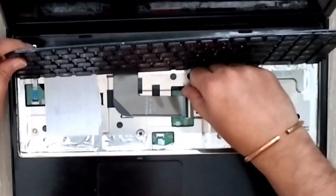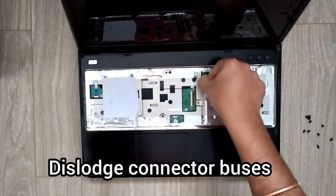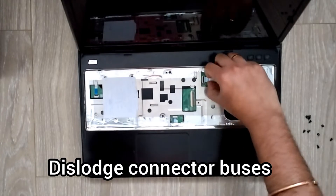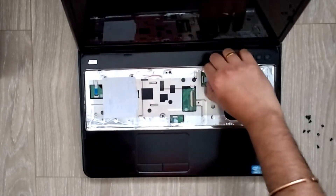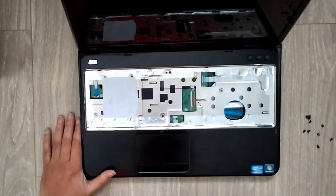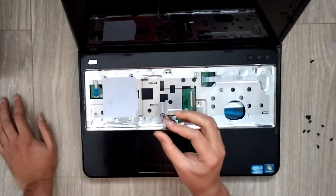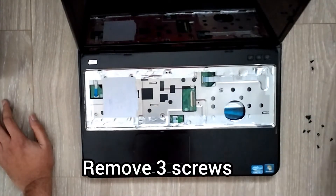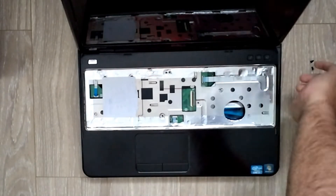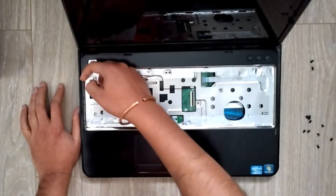You need to take the buses as well - just disconnect this one. There's the keyboard-to-motherboard bus, the trackpad bus, and one for the power button. Once these 3 things are disconnected, go about unscrewing the 3 screws on the keyboard. I forgot to remove the other one so I'll need to remove the third one before the panel comes off.